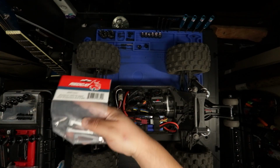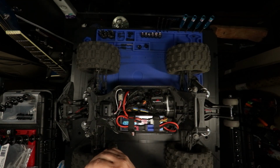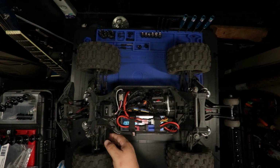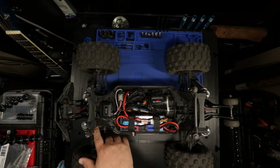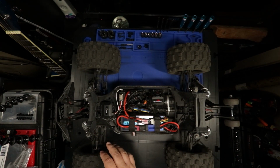There's also an aluminum upgrade for it, like those arms I showed earlier. These arms, but I don't necessarily recommend it. They're pretty expensive, and the wait time on them is pretty long. I also believe they'll adversely affect other parts in the steering geometry, namely the dog bones, and I'd rather replace an $8 set of upper arms than a $35 dog bone and CV combo.